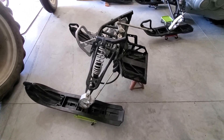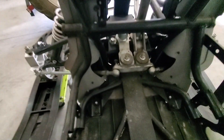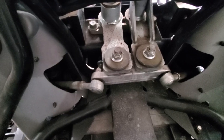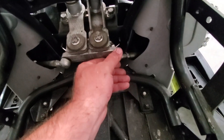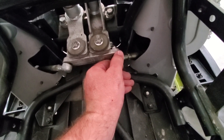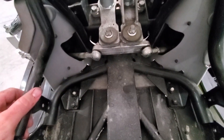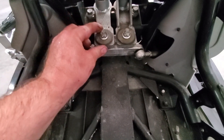So here is the front of the sled. Now you can plainly see the bushings and where the problem is right here — all the slop. But everything else looks good. I found my problem: it was my loose tie rod end. It was simply just this nut right here had worked loose, so there was a little bit of slop in that, but I tightened that all up. Everything else looks good in here. I don't see anything else that's loose other than what the standard kit will address.